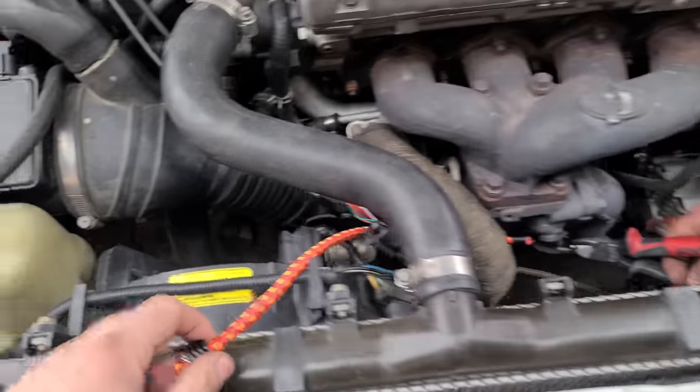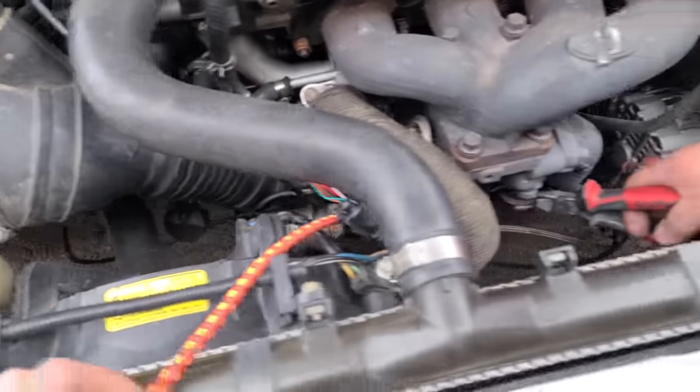Yeah, you're right. We only got 13 PSI of boost. I mean, we should, especially with 10 AFR that's dangerously rich. It's almost like the engine is asking us for more boost for safety purposes. Yeah. It needs some more safety boost. All right, we're listening, Eclipse Motor. We will give you what you want. All right, guys, we cannot take this wastegate apart. It is the stock one.